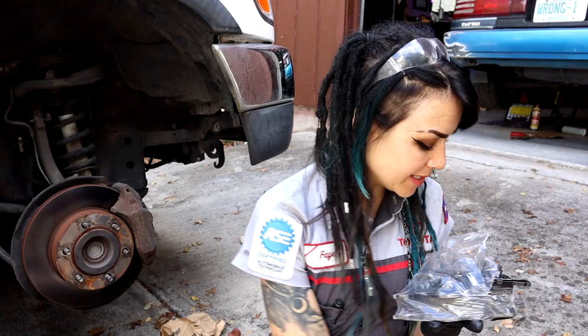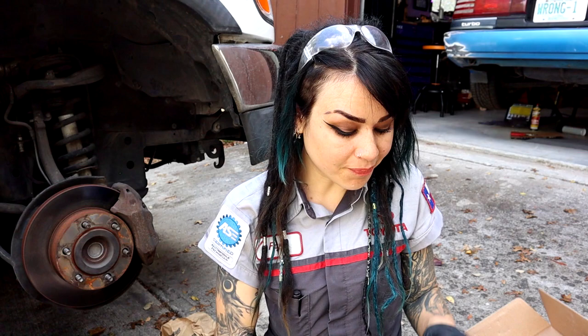This doesn't even come with a hardware kit — that's all that comes in there. So if the mechanic forgets and does not swap over the squealer tab, you can't really listen for that noise, and at that point any noise you hear from your brakes is probably going to be that squeal of metal on metal when you don't have any pad material left.